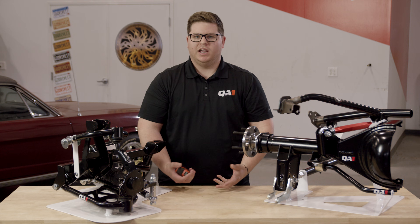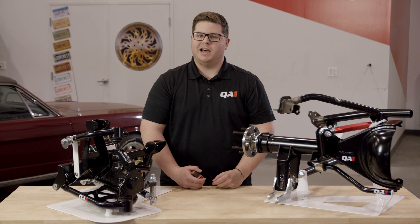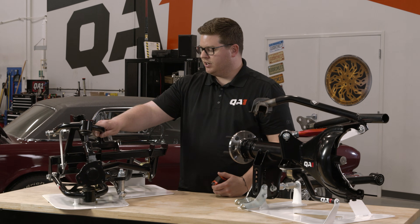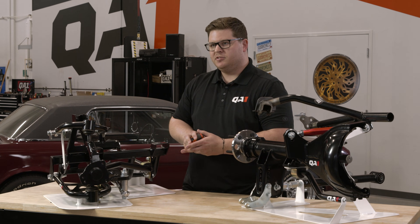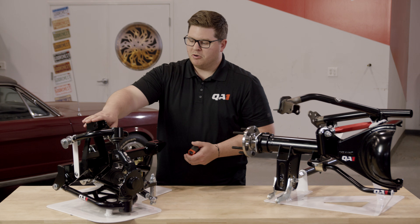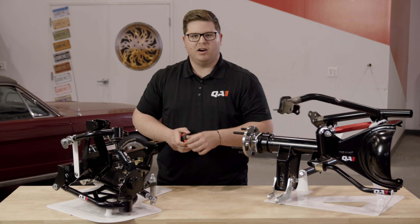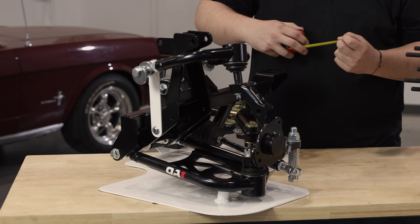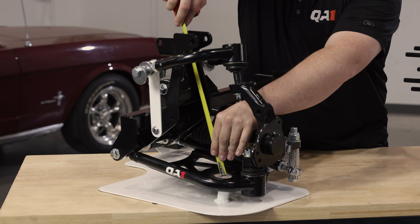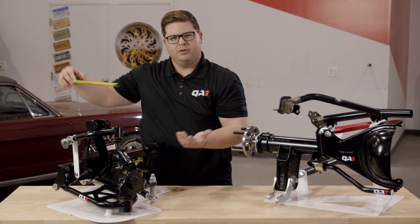In a perfect world, we're going to have at least two and a half inches both ways to avoid bottoming out or topping out that shock. Similarly, looking at a front suspension here — this is an independent suspension so we're going to have our lower T-bar mount on the control arm and a bearing on the upper mount. We're just going to go to the center of the T-bar and then the center of that bearing, drop our tape measure down in there, and take a center to center measurement. I'm looking at 13 inches.